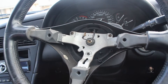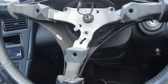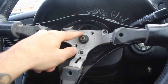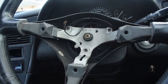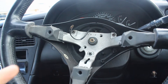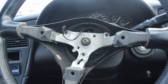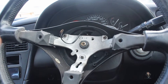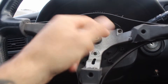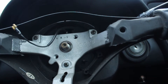Front of the wheel's off — that was super easy. Just a bolt from underneath, then you pull the face off and you have your horn which you disconnect. Should be able to pull the whole assembly out. There's no cruise control on this one which is really good, because when I did the boss kit on Braps they had cruise control so I had to cut shit out of the way and pull out all these other plugs. So this should be super simple. That nut there is 18mm for future reference.